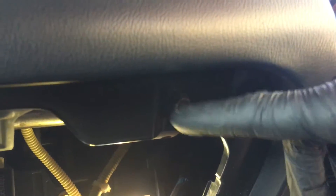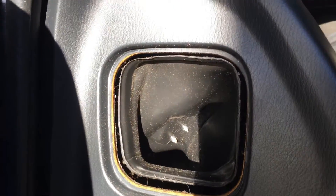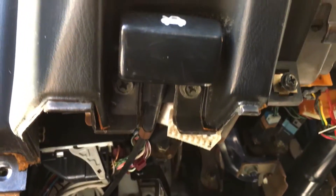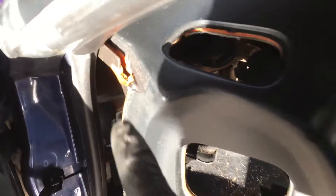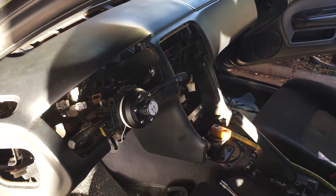You also have two bolts right here under the old glove box connected to a frame. You also have a sneaky one hiding under this vent right here — the bolt from this one has a slightly wider washer, probably to give more support. Obviously there's one right here as well, but there is not one on the driver's side. Don't forget the driver's side one on top, as well as the two bolts that hold in the hood release. At that point there are two clips that hold in the A-pillar, which can be a tricky thing, but after that you should be able to wiggle it and get it right out.